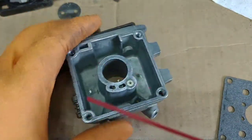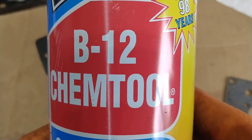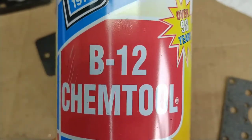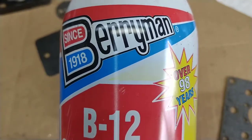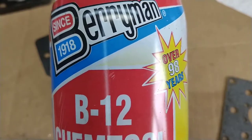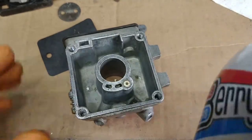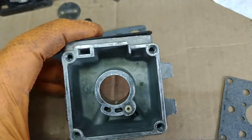You've got to plug some of the holes. Talking about cleaner - the best by far. You can actually read MSDS sheets on all the different carb and choke cleaners and they do vary a lot. What Berryman has that the others don't have as much of is a high level of acetone, and acetone immediately dissolves lacquer. So anytime you can find a carb cleaner that has a lot of acetone when you look at the MSDS, that'll be a good one.